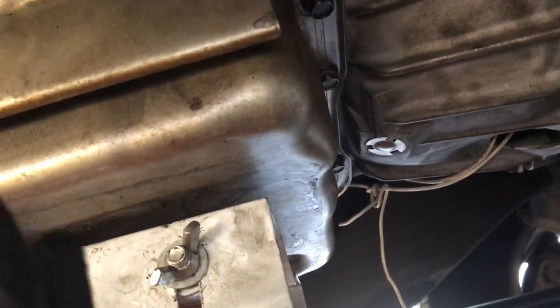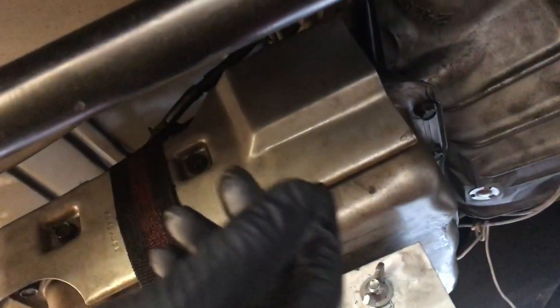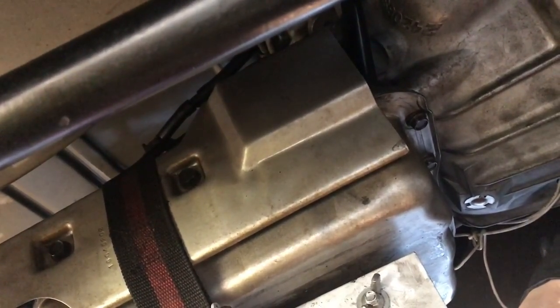because if it slips out and gets out of the pump, and you push the transmission up, and that converter bottoms out against the flex plate, and you tighten these down, you can damage the pump. It can break that gear on the pump. So you need to make sure when you slip this thing up here, there should be a gap between the converter and the flex plate. So right now I have a gap. It's about that far away from the flex plate.